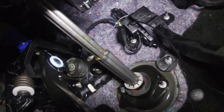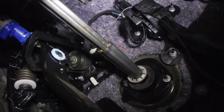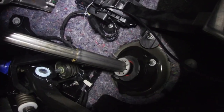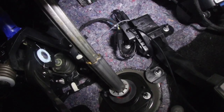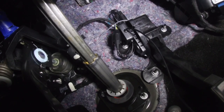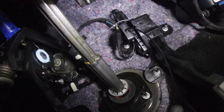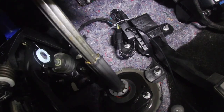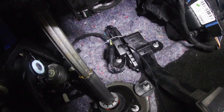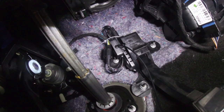After a lot of trial and error, the length of the pigtail is the limiting factor here. There isn't enough harness to securely mount it in a way I felt comfortable with on that plate or anything else nearby. So what we did was put a piece of 3M tape on one side of the box and stuck it to the side of the throttle pedal assembly so the harness is out of the way of the pedal and steering column. Then using one of the supplied zip ties, I loosely wrapped the harness around the top side of the pedal underneath the connector.